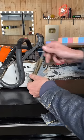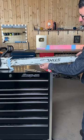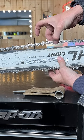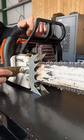Start by loosening both of your bar nuts. With the bar nuts loose, you should be able to move the bar slightly up and down. With one hand, lift up and around the center of the bar, pull your chain up and look at this gap. Way too much. Put a little bit of tension on it and recheck.